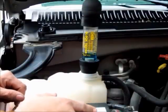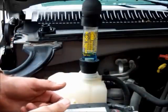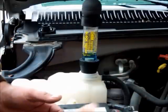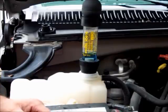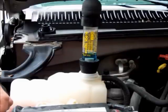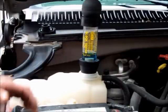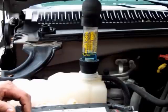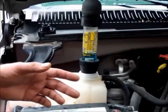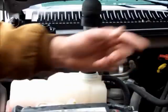Since this is a V8 motor, what I would do is pick one side and pull all the spark plug wires off — disabling the spark on that side. Then start the vehicle up. You might have to let it run five to ten minutes and keep the RPMs up a little to keep it running, since many motors are hard to keep running that way. You will set a check engine light off, but you know why — because you've disabled the spark.